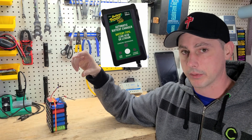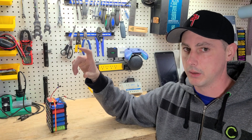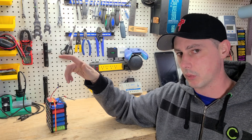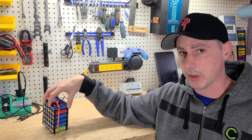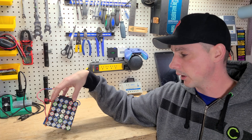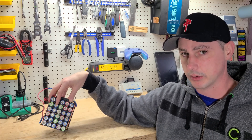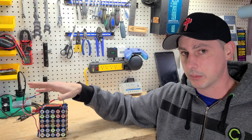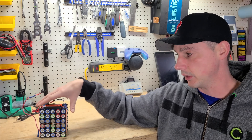I've noticed they've come out with a charger labeled with lithium — I believe it's actually a lithium iron phosphate charger. So that's going to be more for your campers and your boat batteries for your trolling motors. These ones here, you don't want to keep them on a battery maintainer charger. You're going to want to have these between 30 and 50 percent state of charge during the winter. It's a good idea to bring them into the house, keep them at room temperature, keep them half charged, and they'll last you for years and years.